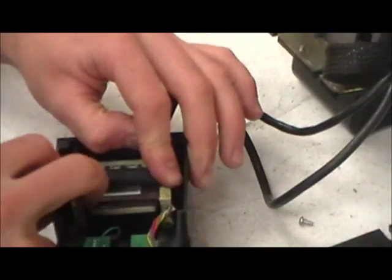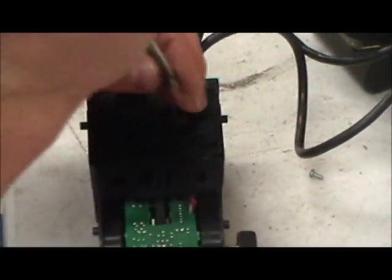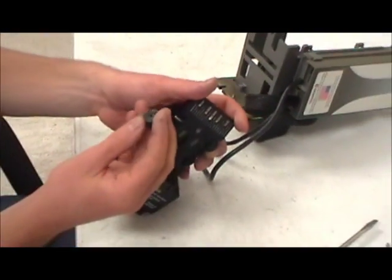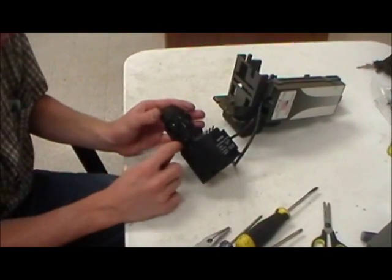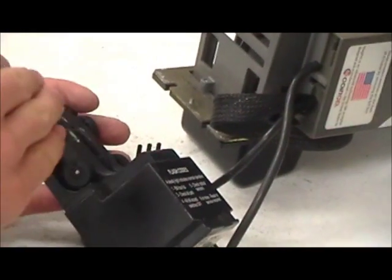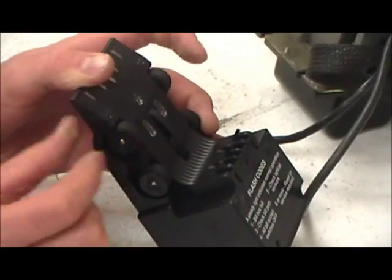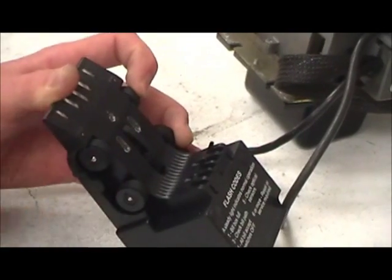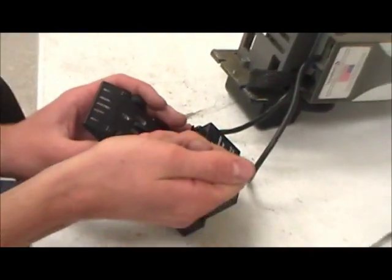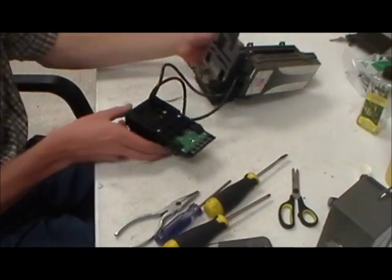Don't forget your hose that holds the transformer in place, if you are using a transformer — some units don't have one, and a 24-volt unit won't have a transformer. The spring should hold the wheels up above the level of the housing just a little bit. If the spring is in the wrong place, the axle will sit all the way down on the housing, and you'll know just from seeing that they're in the wrong place. If you turn it back on and it takes the bill in about half an inch and spits it back out, the spring is probably on the wrong side of one of the axles. Just take the lower assembly apart, check, and that should fix the problem.